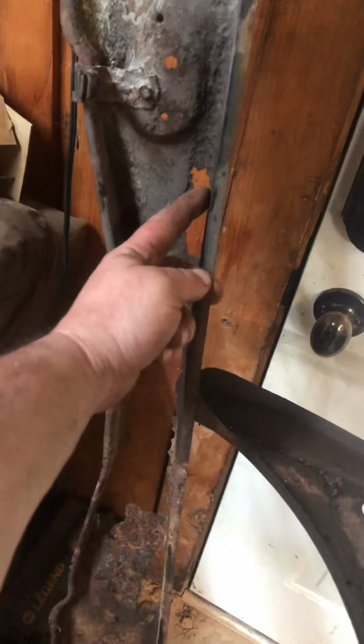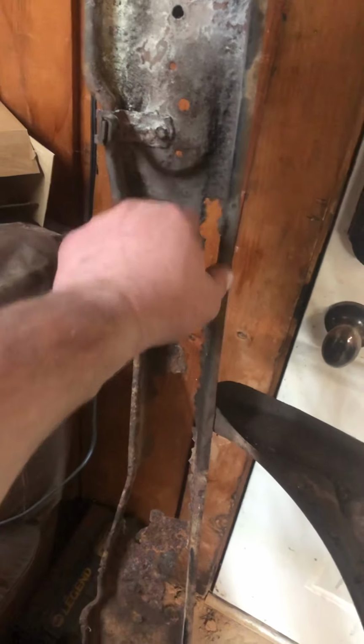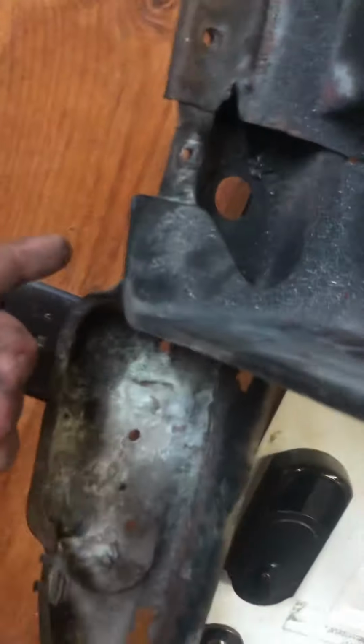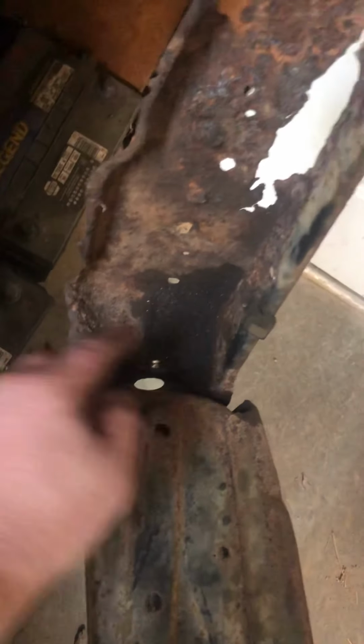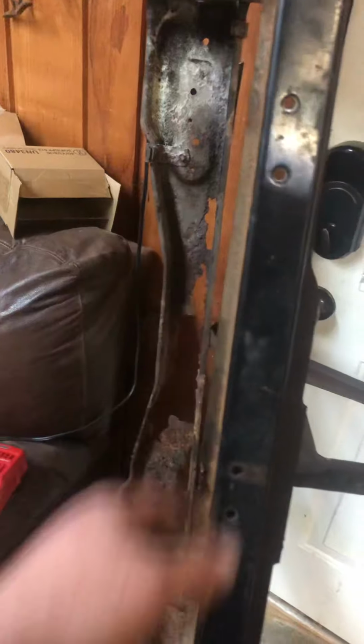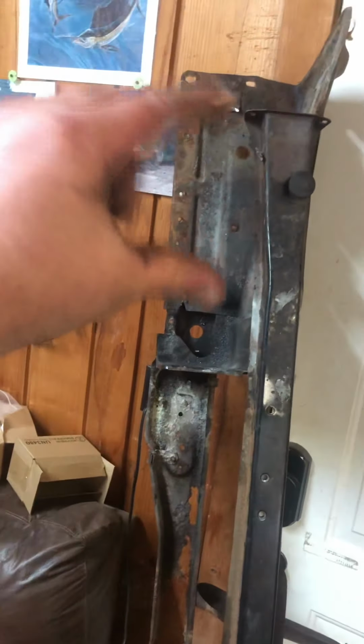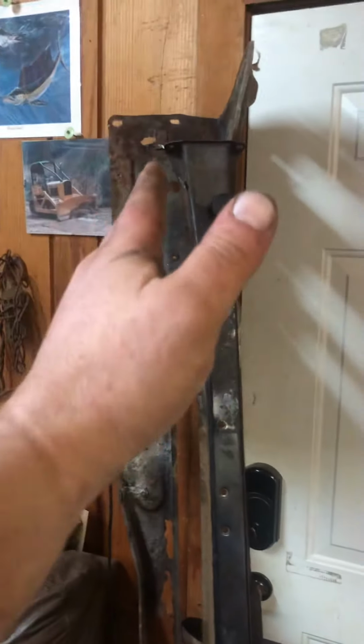All you have to do is weld a piece in the bottom. Cut this edge, and cut a piece and put it in there. That's solid. It's solid up to here. So cut this out, or pop yours loose right there and there, and stick your bottom piece in there. Or fix this one. So you've actually got a backup from this one and your other one. But I think yours is bent on this side from your wreck. So that's the perfect side.